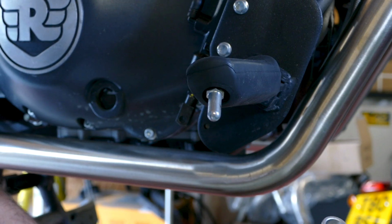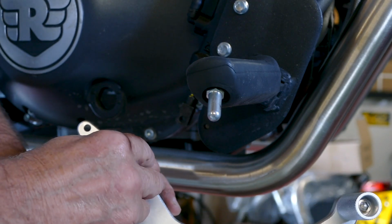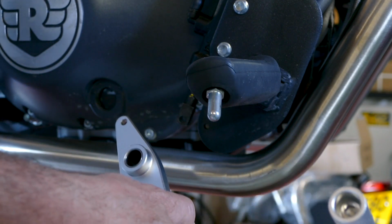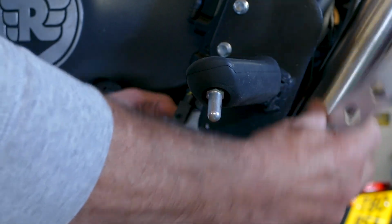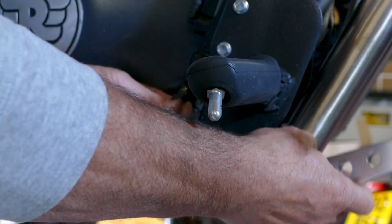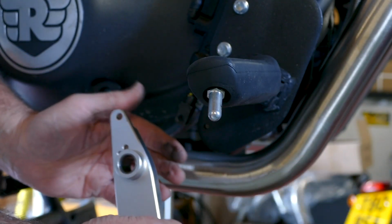Now on the new brake lever, we've actually put 2 spring pivot holes in, because on some springs we found that they didn't have a very good tension on them, so we added one a little bit further around just to give you a bit more tension on the brake. So before you fit it, just try it on the spindle first to make sure it's a good free fit. If it's not, just make sure you haven't got any nicks or burrs either on the bush or the shaft. But it's important that it's free to move. If it's tight, it could cause the brake to stick on.